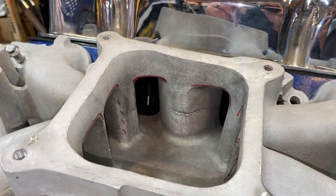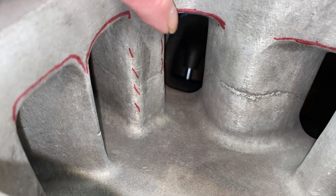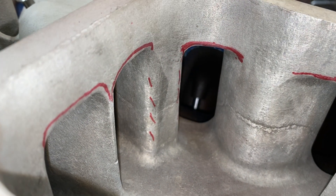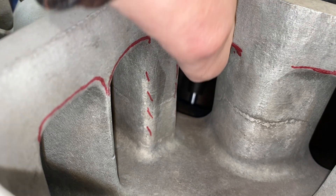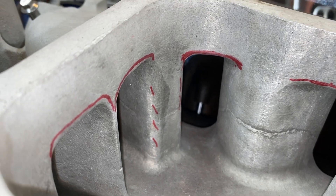Here's another look at it. You can see the valve right there — that one's a little bit better. But look at this. I can fix that, remove that. Because when you look down through the carburetor, you can tell the air hits this and it has to go underneath. I want to smooth that radius, because it's like 90 degrees. And air doesn't like to turn 90 degrees.